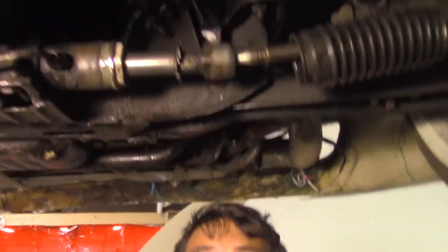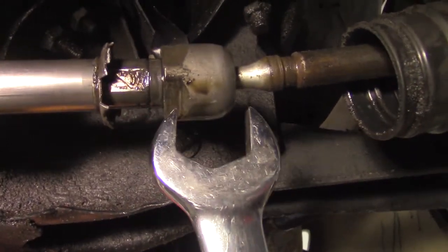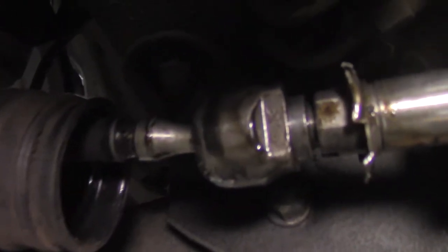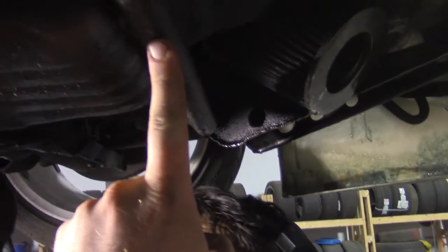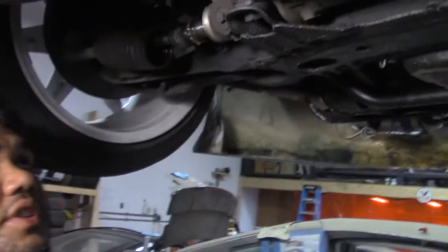So this is a thing that happens when this one is still here. You solid mount your car. That doesn't move, and that does. If you can stay with some sort of rubber or even a hard plastic motor mount bushing and transmission bushing, try and stay that route, especially for a car that sees street use, because all the vibration from the motor, start and stop, going through the revs, potholes, and the car will rattle itself to pieces. But it had to be solid in this particular instance, because this touches this, and then this breaks, and all the oil comes out. I don't think we've done rack bushings in this, so that might be our only saving grace.